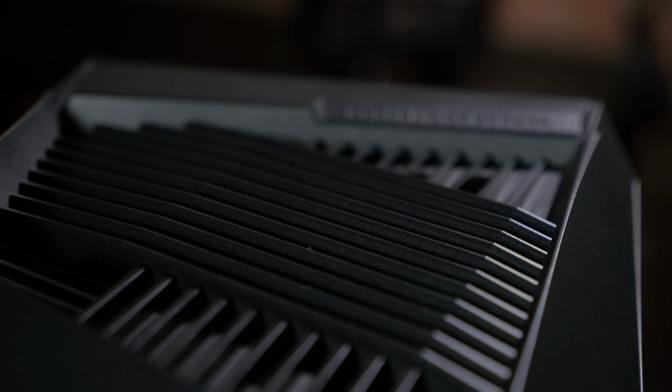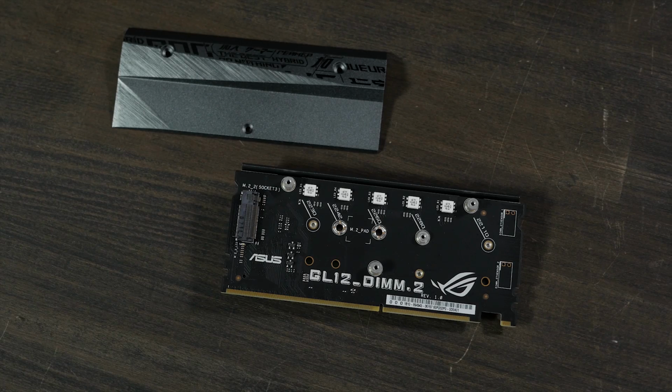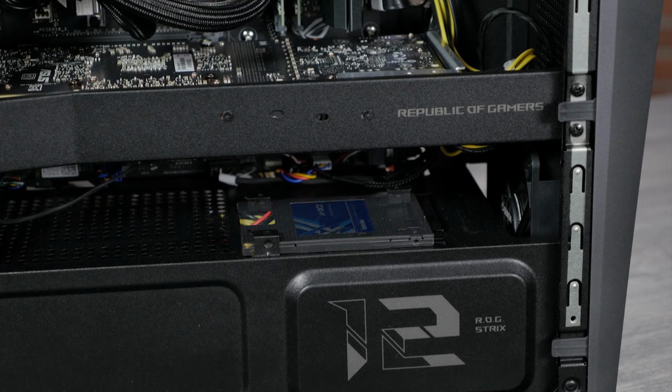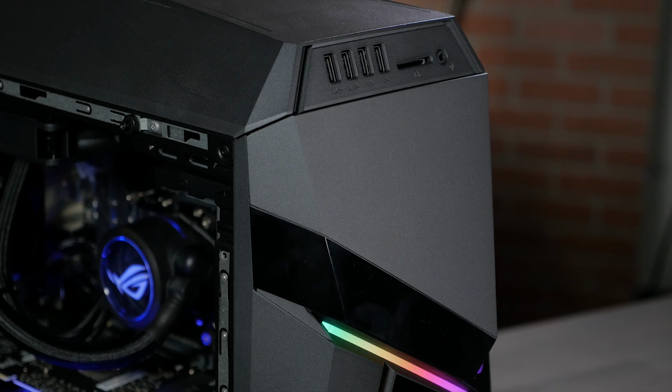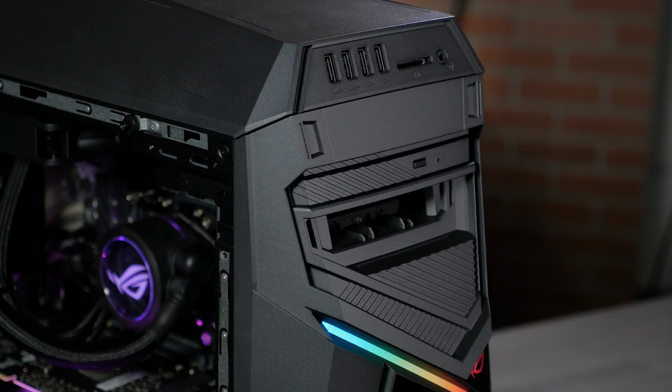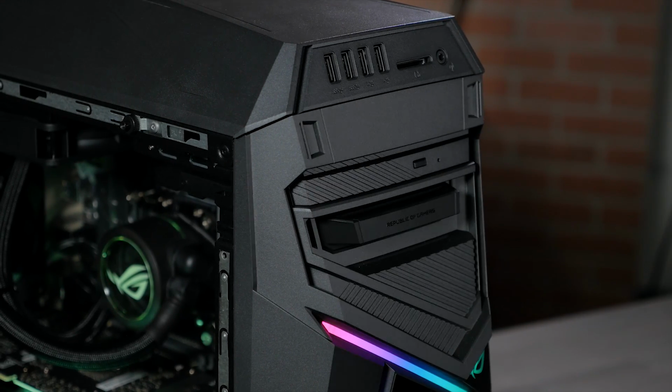It comes with up to a 512 GB NVMe M.2 SSD in addition to a 2 TB HDD. However, this system was built with upgrading in mind, so there's an additional NVMe M.2 slot, a 2.5-inch drive bay, and an extra 3.5-inch drive bay. There's also a hot swap 2.5-inch SSD tray to make it super easy to transfer over game settings in an esports environment or to transfer large files between systems.